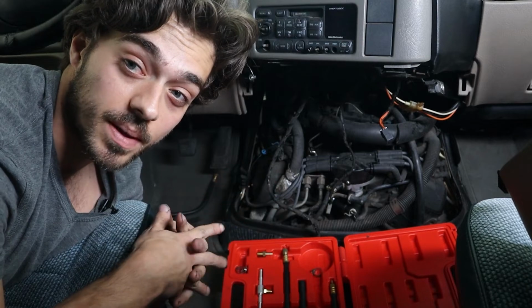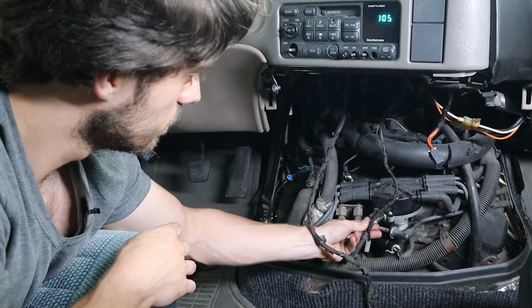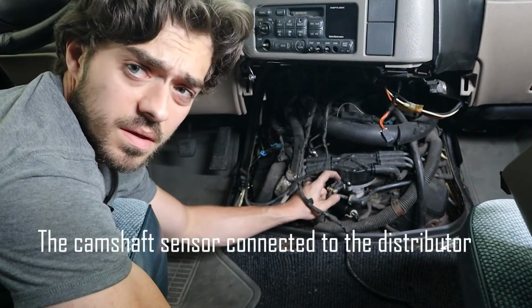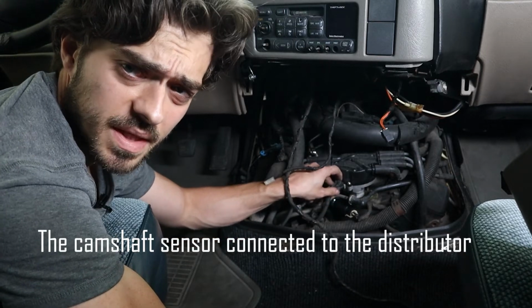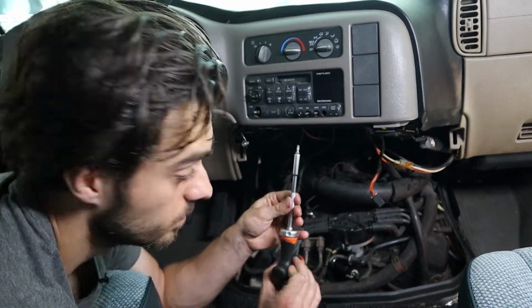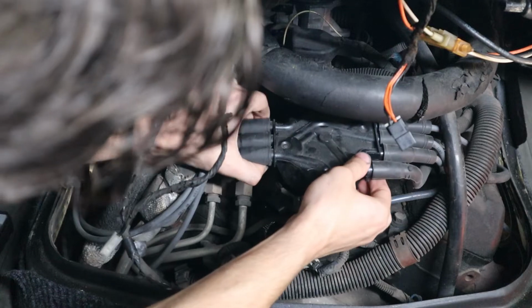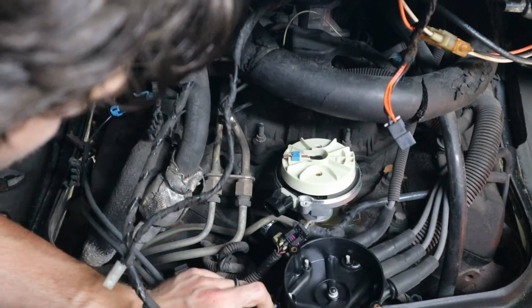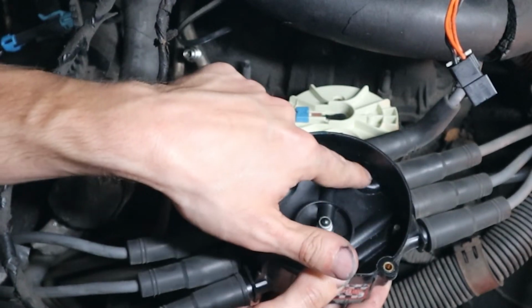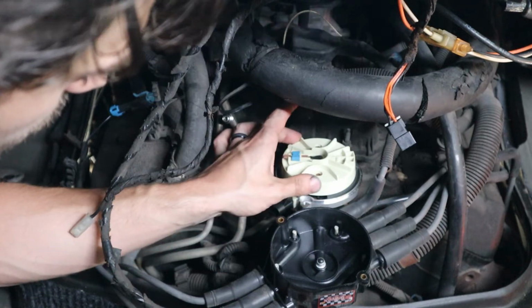It should hover around 55 to 60 PSI. So when I mess with this plug, it seems like it hesitates some more, so I'm gonna unplug that. It's a T20. The contact points do have a bit of corrosion, so I'm gonna clean them up. I firmly believe that's just the right amount of play. I think that's normal.